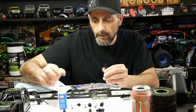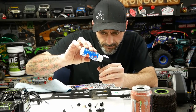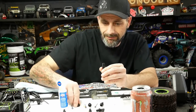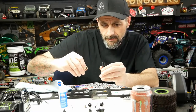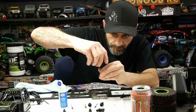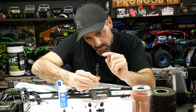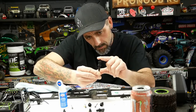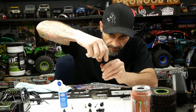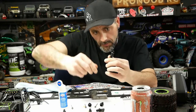It's getting just a little boot at the end, so we're going to put in just a drop. Ooh. Okay, 1.5. See, that is air. See that? No good. So another thing you can do to bleed the air is just loosen this guy and go, and then tighten him and check again.